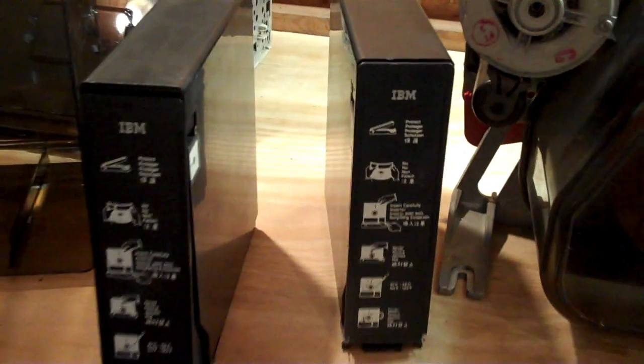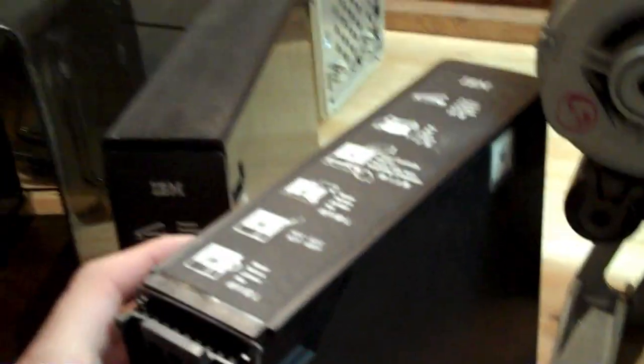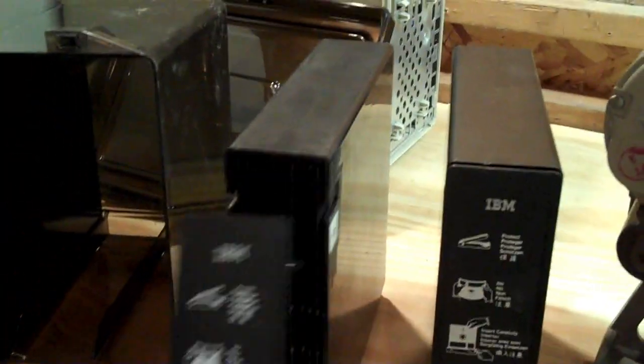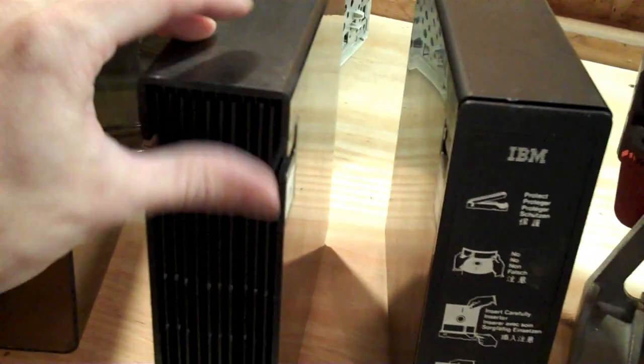So this is the hard drive unit — usually there's a cover here, by the way; I popped it off for you. Here are the jukeboxes for the drive. This is AA14 volume 2, whatever the hell AA14 is. If we look at the unit here you can see the individual floppies, and the way it works is when it's inserted into the drive, the drive levers this down which then allows the cover to ratchet off. And then the individual 8-inch floppies slide in here.